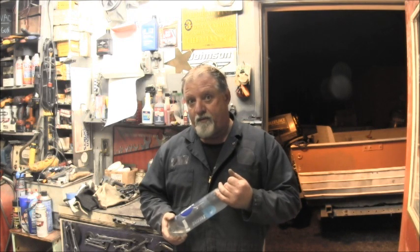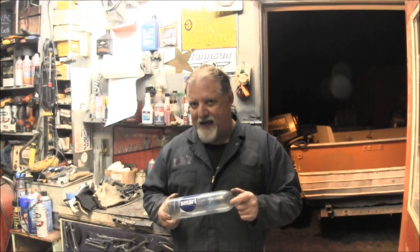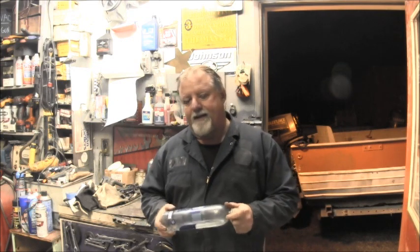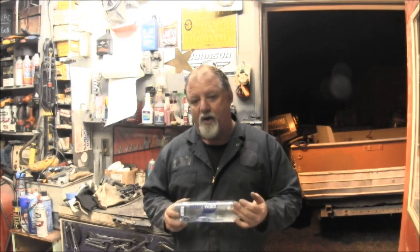I'm going to drop this lower unit one more time. And if I can't see a bend in that drive shaft or something, I did not check that. It seemed perfectly straight. I didn't really examine the splines on it real close on either end. But when I went to get it up into that crank, I had to pop it with my soft mallet. And then it went on a pin. And now when I spin it over with the half Milwaukee, it's pumping water, so I know that the water pump impeller and the pickup tube is in the grommet.